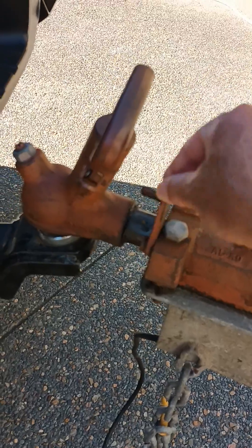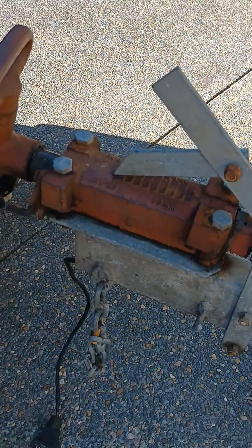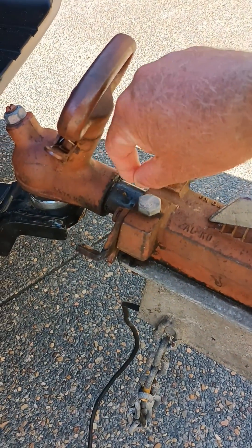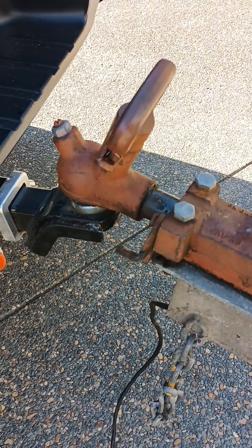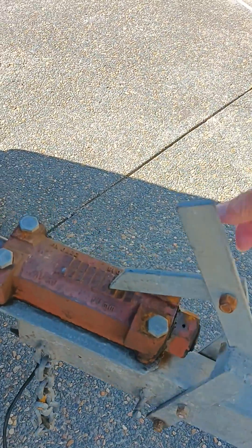Now that we're going to drive on the highway I have to pull that back, but you don't want to leave the trailer brakes like that with this flap here — because when you brake, that squeezes in and eventually you drive along with your brakes on.